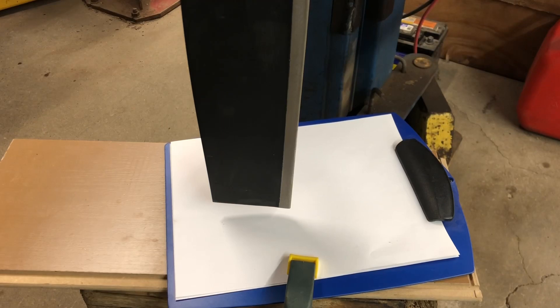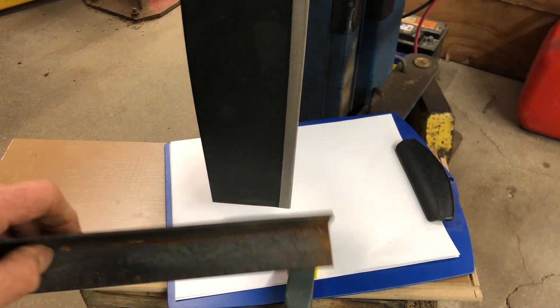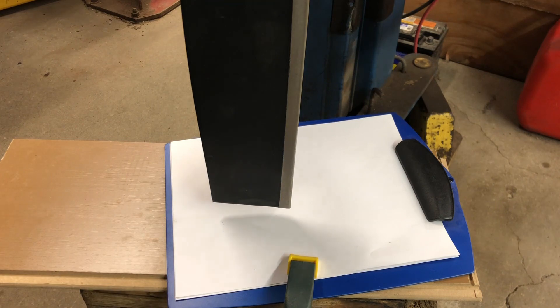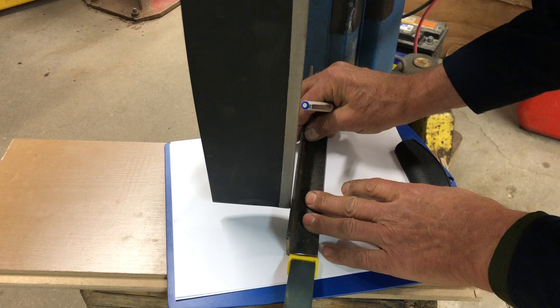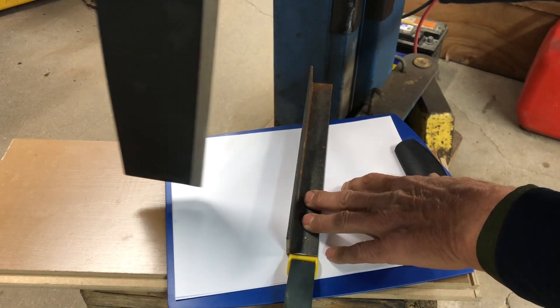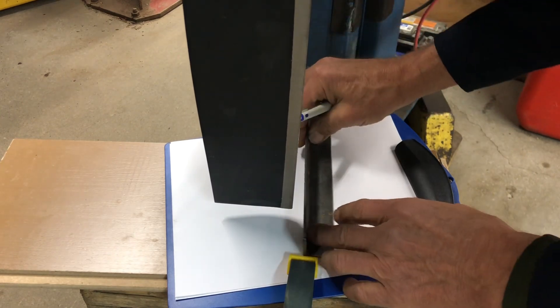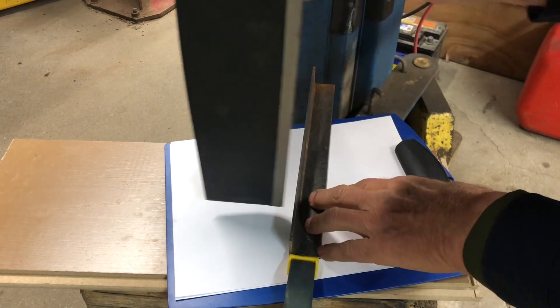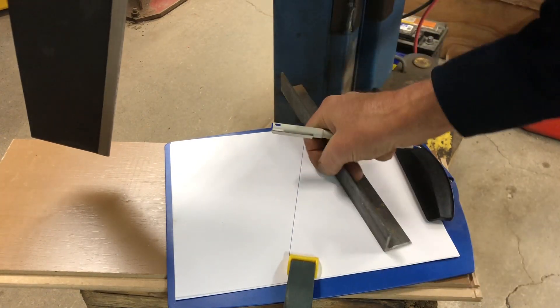First thing in checking the tracking: I have a box — anything will work that you can use under the propeller — with an extra piece of wood for a spacer. I'm just using a piece of angle iron; aluminum would be a little more elegant. Now it's very important that the prop stops in the same place every time, so I'm going to draw a straight line right there.